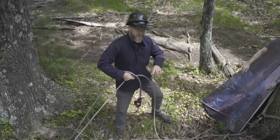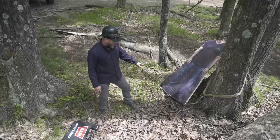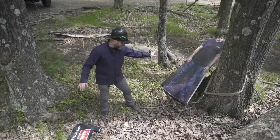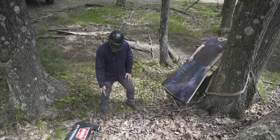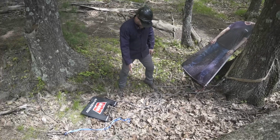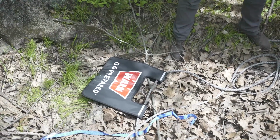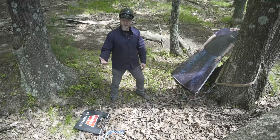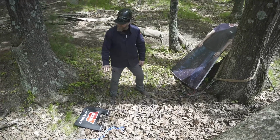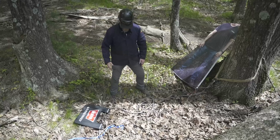Before, the hook went flying all the way to where behind Cardboard Josh is. Maybe not that hard, but pretty much. Compared to that, with the weighted blanket on it, it actually fell right here, even a few feet short of its previous distance. So that makes a huge difference. That is definitely needed any time anybody's going to be winching: using a weighted blanket.